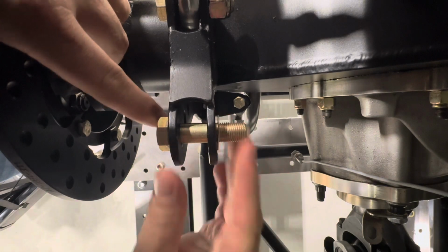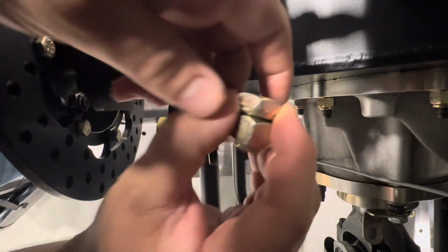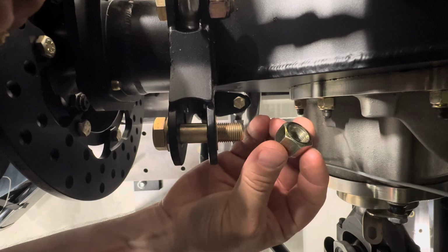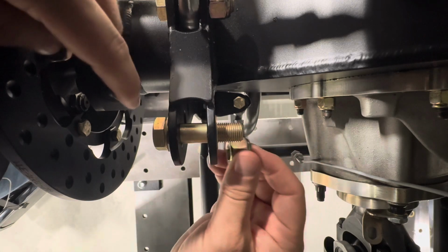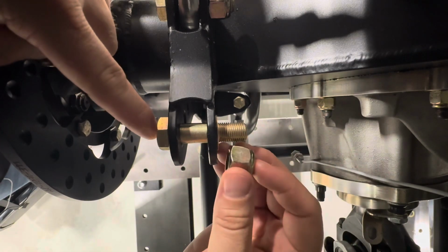Then put it on both, you can still see there's still some of the grip length coming through. Something to keep in mind is that here's a couple different options we've got for the fastener, for the nut. Notice there's almost like a little recessed lead-in portion of it. This will actually go past the threads because that diameter lead-in is larger than the threads, so it will go a little bit past that.